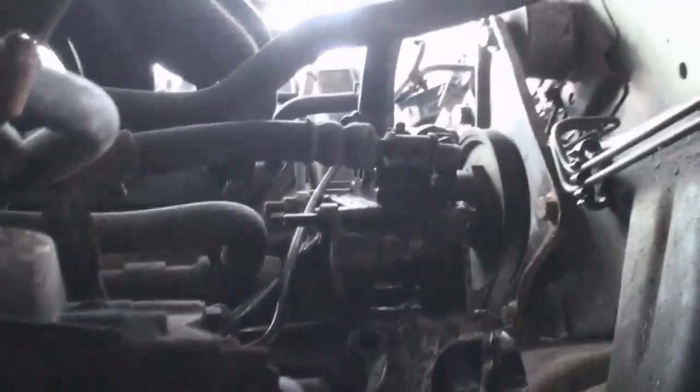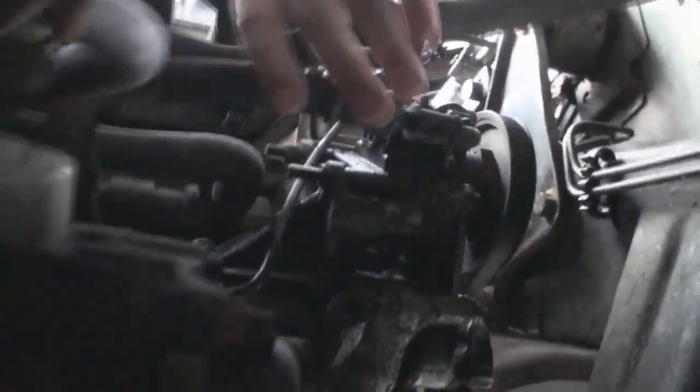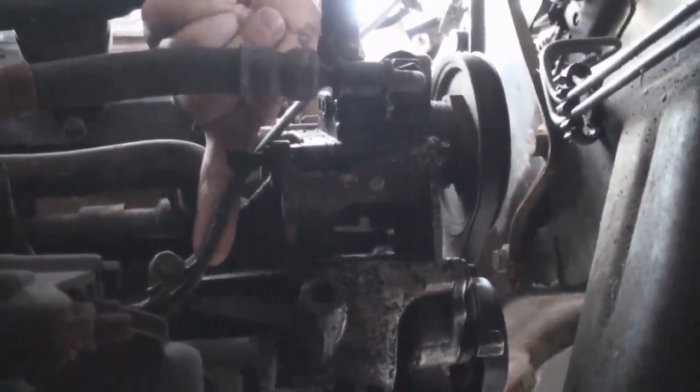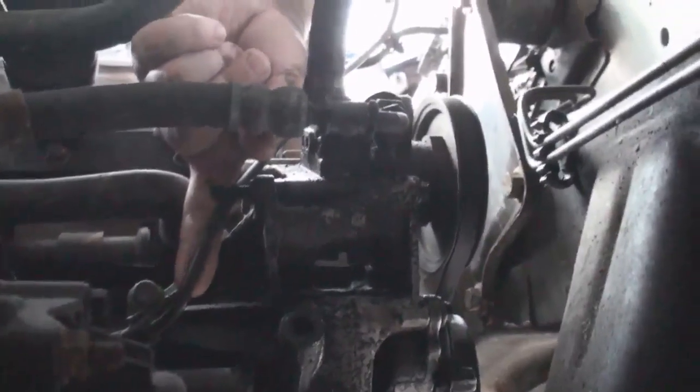Is it in there? Just stick your hand in the bonnet for a minute, Gary. That's it, that bit further down, there's a little pipe down underneath them. Oh, this one? Yeah. Now that pipe there, what you can see, is a little breather pipe which has got to pull off at the top of the IRD unit as well, so that's got to be done as well. So I'm now going to try and undo them top bolts, as I said to you, by hand, over the top there, separate from the gearbox and hopefully pull this out.